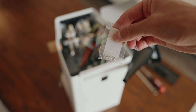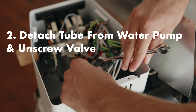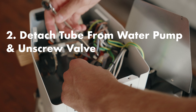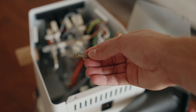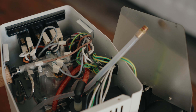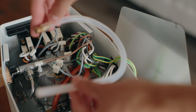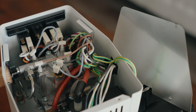Now, step two — here is the 9-bar spring. We want to wiggle loose this tube here, and this is where the 10 millimeter wrench comes in. Ideally, you would just want to be able to loosen this with your hand and pull it off, but my tube was exceedingly tight, so I ended up unscrewing it while the tube was still attached. Do this gingerly as you do not want to break the water pump. I was still having a hard time pulling this thing out, so I just went ahead and took the whole tube out so I could get some more leverage on it and wiggle it out.